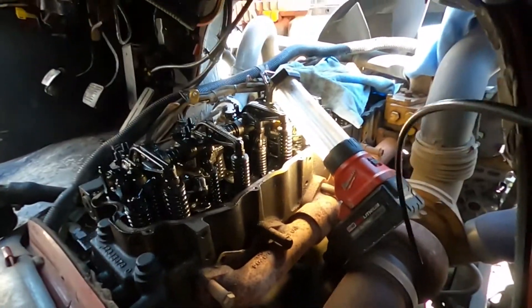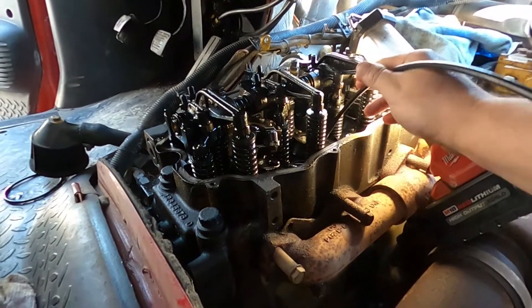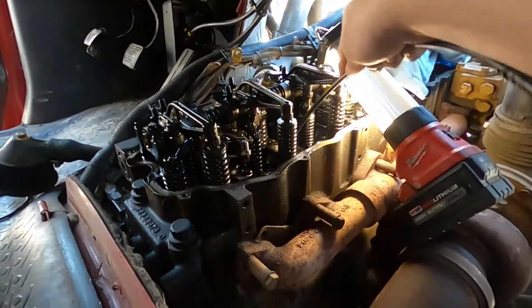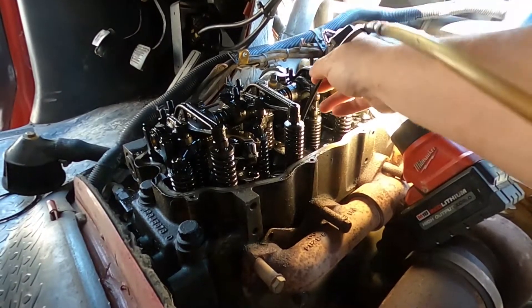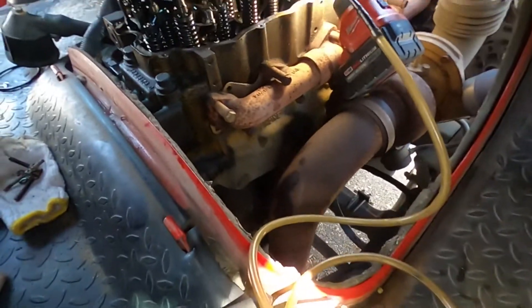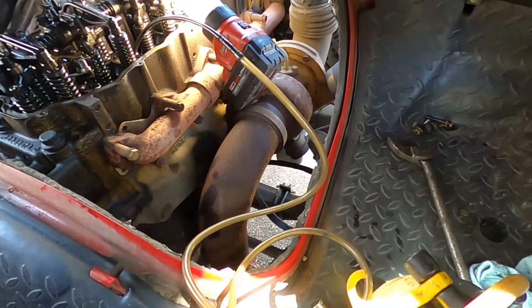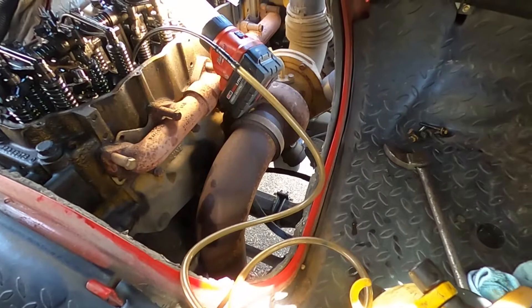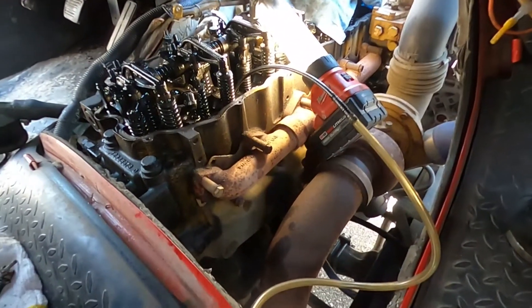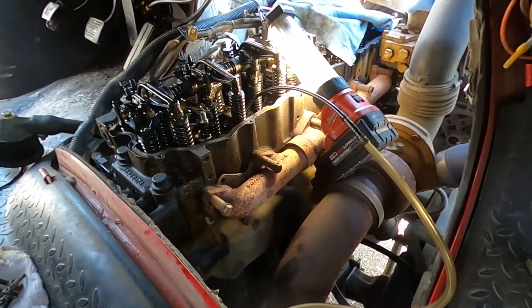I had a little brain fart — I forgot: I was thinking of international injectors. These injectors don't have the copper washer at the bottom, the compression washer. Put the tube down until it goes into the hole and bottoms out, use the little suction to suck it out. You also want to spray in there, clean it out with a little rag, get it nice and clean. Then take the new one, oil it up, pop it in there, and torque it down.